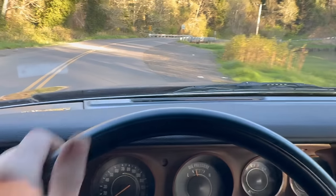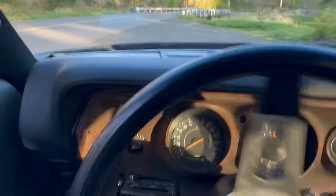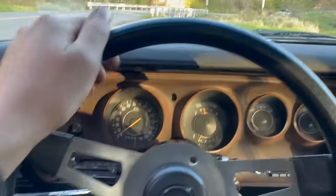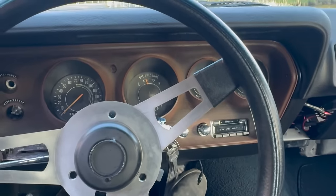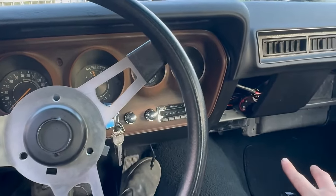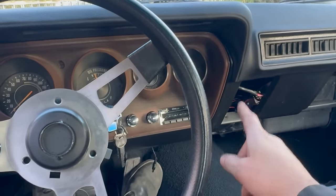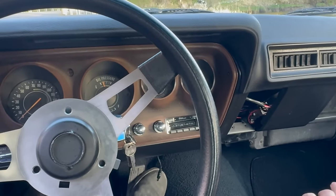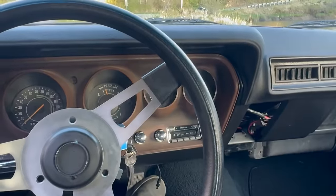It stalled the moment I turned the camera off. Yeah, maybe a little bump in the idle speed. Definitely a little bump in the idle speed. Actually, I had another thought. What if, when it goes in gear, the vacuum falls off, the timing goes away a little bit, the vacuum falls off even more, and then my new much lower idle mixture setting is way too low, it leans out and dies. I could test the theory now, but I didn't bring a screwdriver.